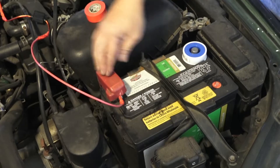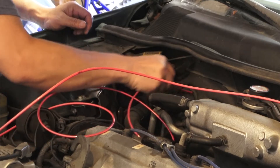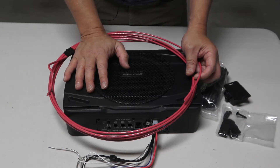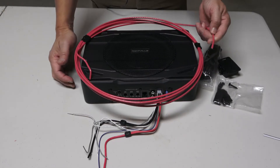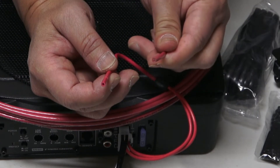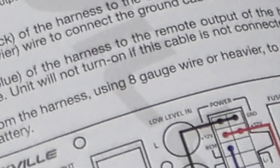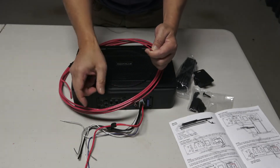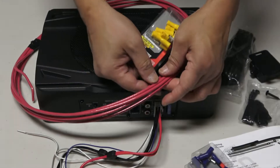You do have to buy additional items. I went to Home Depot and purchased a 10-gauge wire for the battery, because you have to run the wire from the front of your car, through the firewall, and connect it to the subwoofer. Depending on placement, measure for the right length. The manual recommends 8-gauge wire for both ground and positive, but 8-gauge is quite big and presents some challenges connecting to a smaller wire.